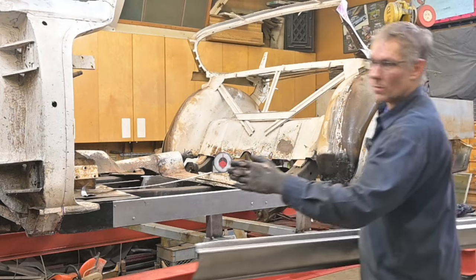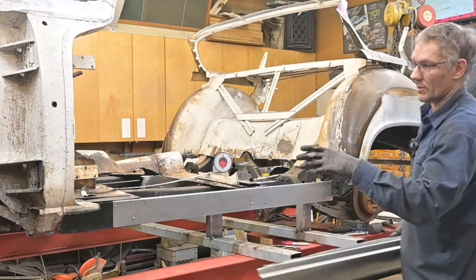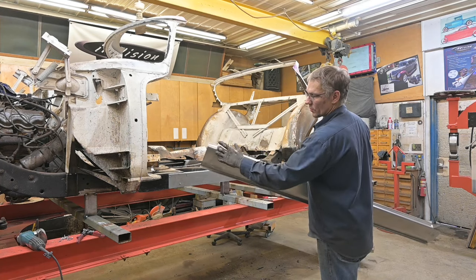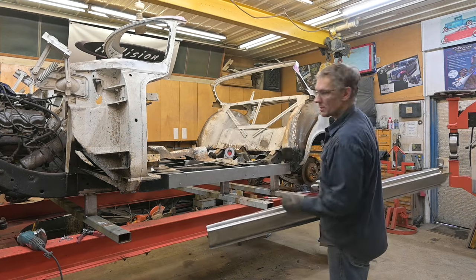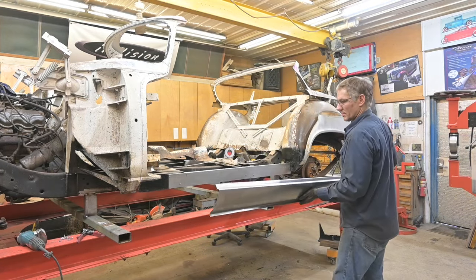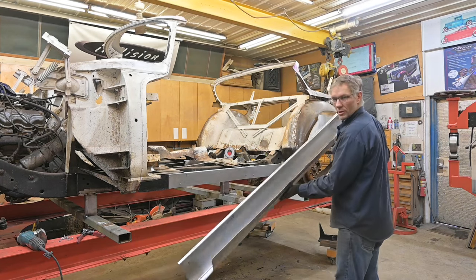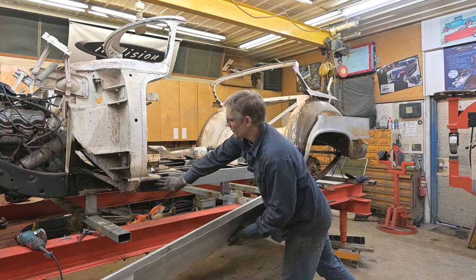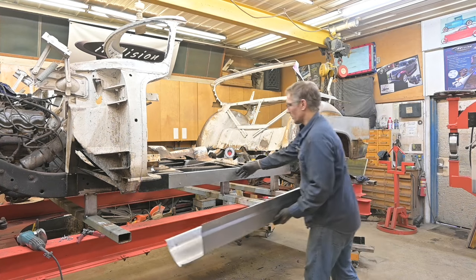I'm not trusting what the guy did previously. There's a bunch of stuff that was done, I don't even talk about it. So when we get the front fenders on, then we'll make the decision as to where that falls, cut it off, and blend it in to the door post. Right now, we'll clamp this in place and see how it looks. This is all on screws because it all has to come apart. We have to clean, wash, sand, and epoxy prime everything, just like we did here. That's finished, so that's almost ready for welding, but all this has to be prepared yet.